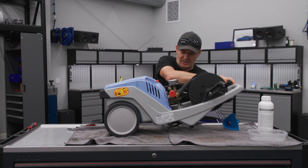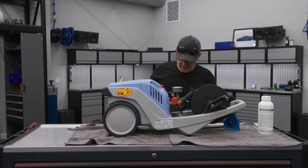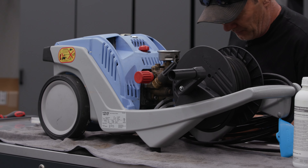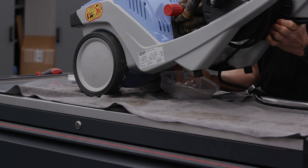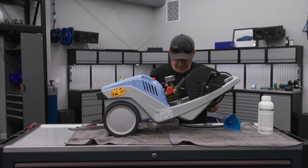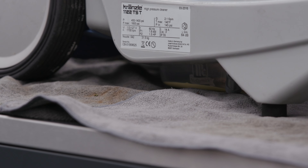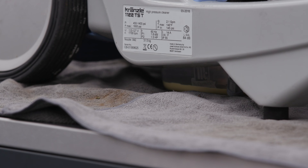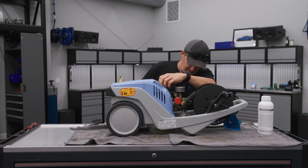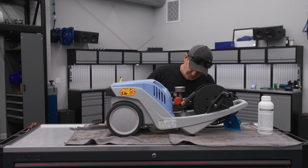Tip it down. Hopefully I can reach in here with my fingers and get my oil pan under here. What I'm using is a little 32-ounce Rubbermaid Tupperware so it fits under here — there's just not much clearance. I'll loosen it by hand and there it comes. As you can see, my oil is rather milky, which means it's a good thing I'm doing the service now. Obviously my seals are letting water into the oil side. That is not great, but we will fix that.